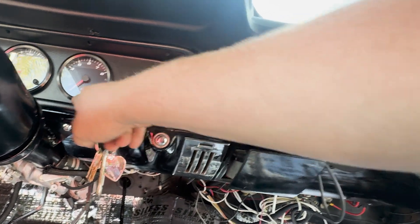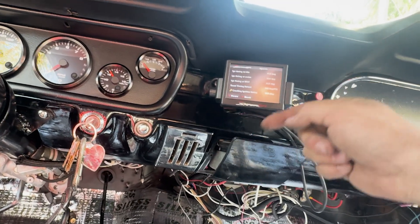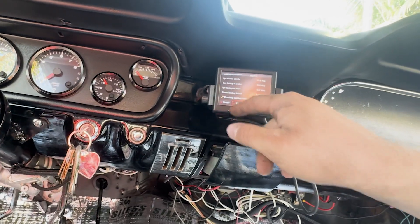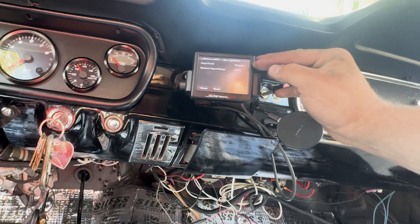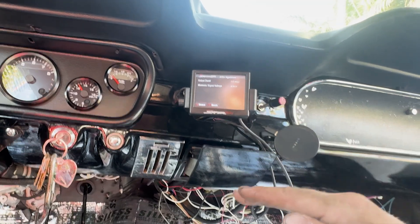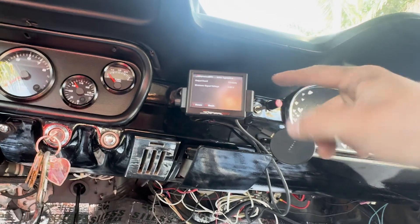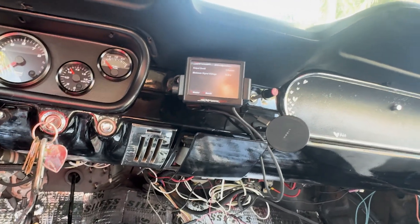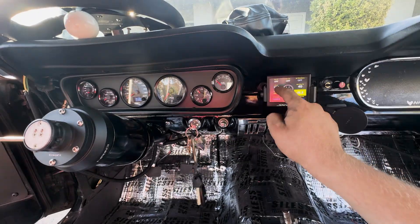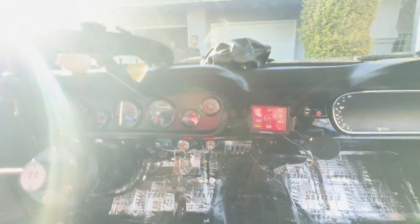We accidentally disconnected the sensor so it's reading inaccurately — we'll sort that out. Going to Spark, we're not going to run a timing table yet; we're going to run ignition at idle, at cruise, and at wide open throttle. Cranking timing numbers are fine for right now. Under Advanced Ignition, we want dwell set to 2.0 milliseconds — that's right for this style of TFI/HEI coil. Minimum signal voltage — how much voltage the signal needs to have to detect a trigger — I'm starting with 0.35, the Holley default. If we have a noisy signal we might raise it to 0.5 or 0.75, but we'll go with this for now.